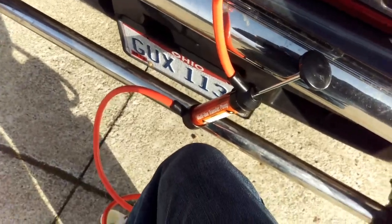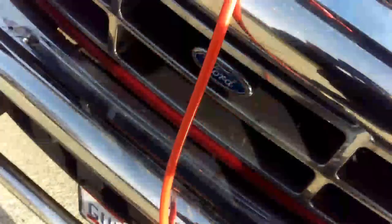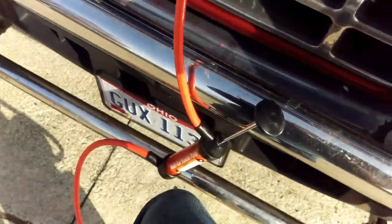I'm going to have to say this way is the best way so far if you don't have any expensive equipment. A fluid extractor or multi-use transfer pump from Harbor Freight, a worm clamp, a couple pieces of hose and copper pipe just to get down there — something stiff — and you'll be good. HPOP.